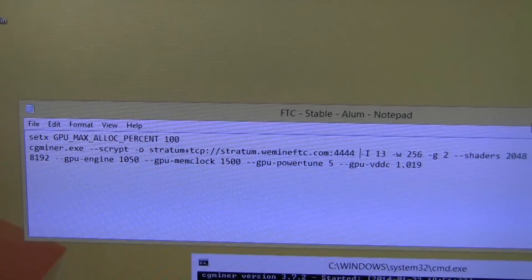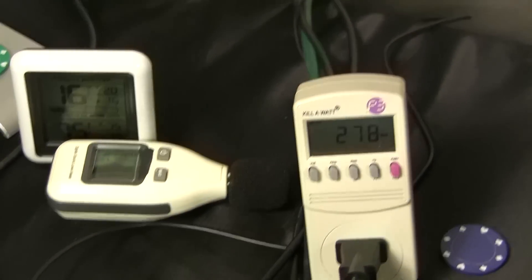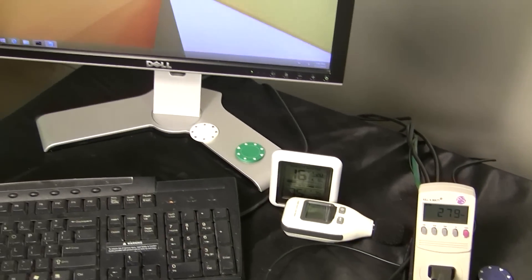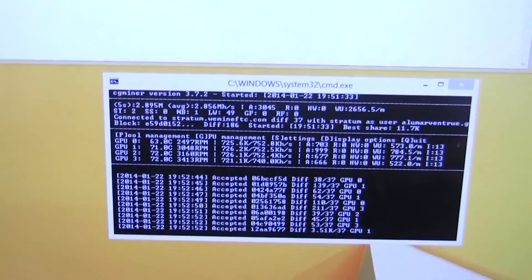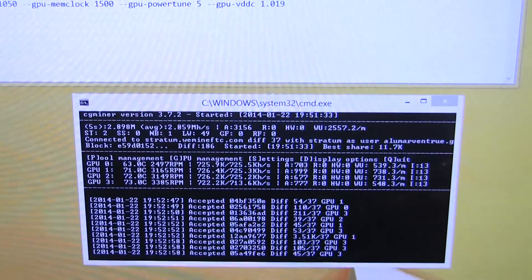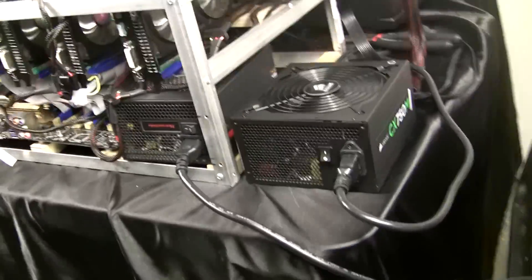We take another shot and bump it up just a hair — 1050 core — get a little more on that kilowatt. It stabilizes right around 280 AC to the wall and we lock in at 730, which is a real good number for these cards. The fastest we've seen them hold stable is around 741–745 with these Windforce Gigabytes. Quick shot of the kilowatt showing about 280, roughly 80% efficiency, not too bad.